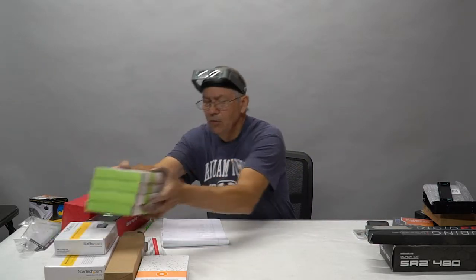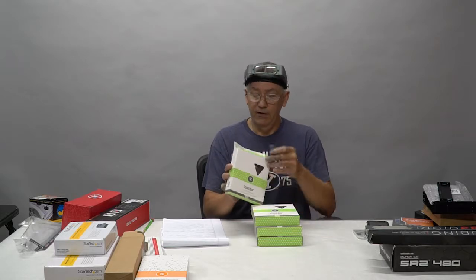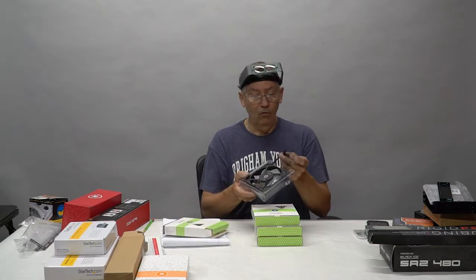Now, the fans we're using on the cooling, really cool stuff. These are EK Vardar fans. They're 1,850 RPM each. They're relatively high pressure fans. They're meant to push a lot of air through radiators. If you put a low pressure fan up to a radiator, the air will come out the back. It won't go through the radiator, but the propellers on this are designed to press through into the radiator. They're also extremely quiet fans, and the wires are shielded.